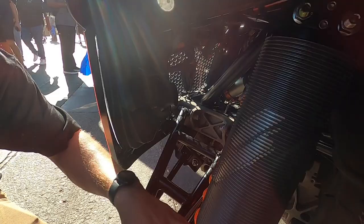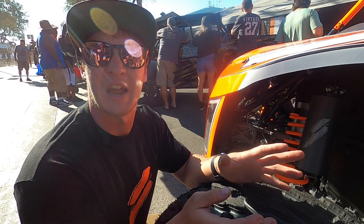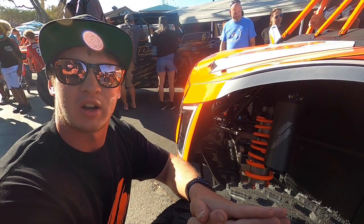Yeah, let's check out the front bulkhead here. I was talking about the bulkhead a few minutes ago, but Connor, obviously, is the expert, and he's going to show us a little bit what's going on. First of all, we're a shock to bottom car, which means we have much more stroke length in the travel, and we can create position dampening dependent on where we are in the travel. At full bump, we have a hydraulic bump stop built in, so it's never going to hard bottom out on the bottom of the shock. It just gets a lot stiffer at the very last few inches of stroke.